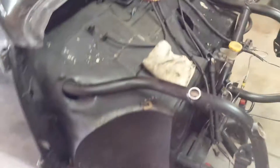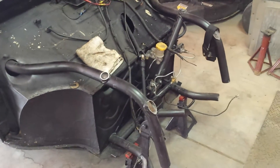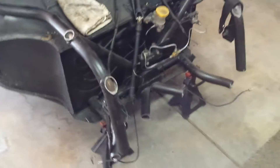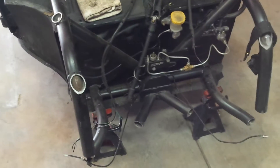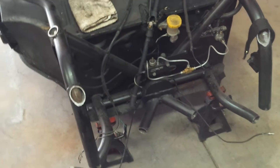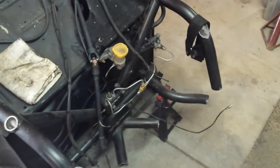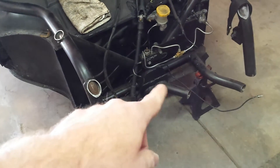Here's the front of the car. It was all caged out — I had the beam welded directly to the cage, but as you can see my widened beam is gone. I plan on putting a link pin frame head on here for the front suspension. I'm going to tie these upper tubes and the lower tubes into the beam as well, and the center piece is going to get cut off.